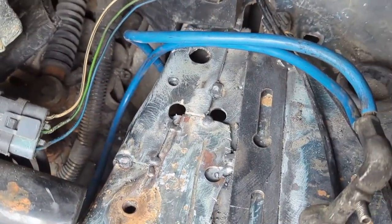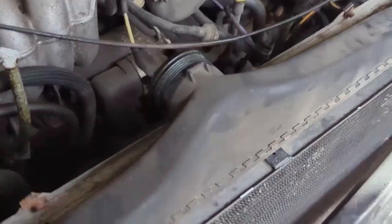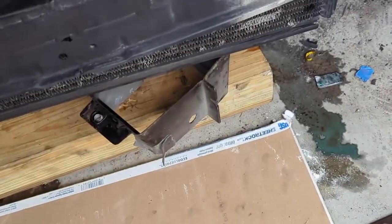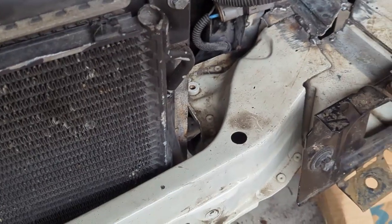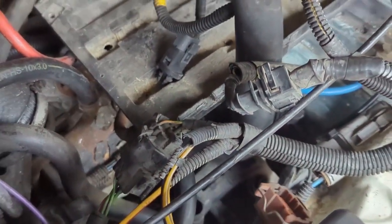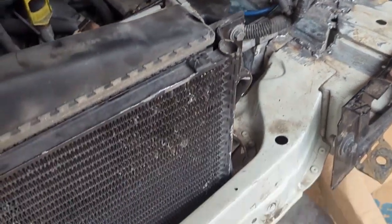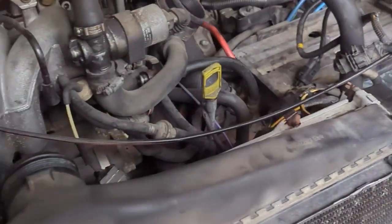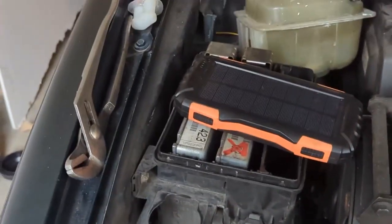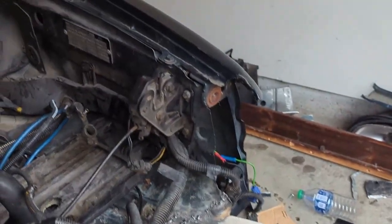I'll come back with probably another battery tray and two fresh bolts to put that in properly. I've decided to put the radiator in since I don't have ramps. Before I got this front clip on, I got this side tightened down and this side supported because I'm not confident in the curing of that epoxy over there yet. So I had to take the SAS pump loose again so I can get the radiator in here with the car on the ground. If you ever take the radiator in and out from the top with the car on the ground, you'll normally have to move that SAS pump. Got it in, got the computer box in, and I'm going to put the lid on that. Next I'm going to put this front clip across here.